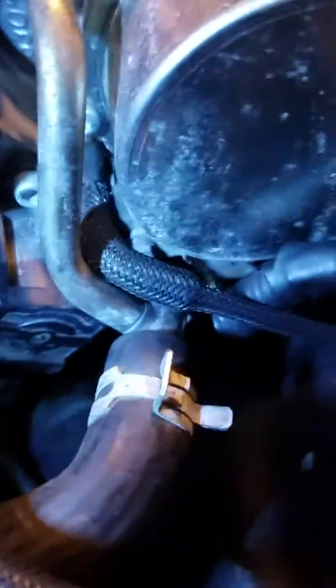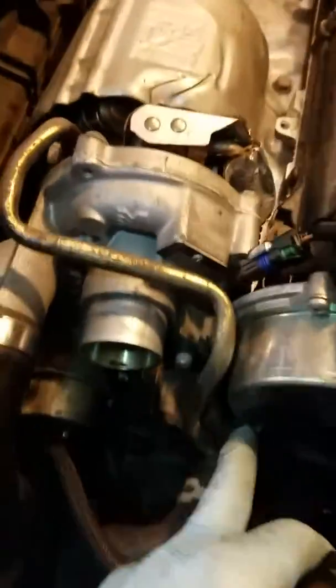Alrighty, so next we're going to remove these vacuum lines to the turbo wastegate. Here's one here. Pull this off, and this is the longer of the two. There's another one right here. Let's see if we can get a light on there a little better. Yeah, there's one right here and here. The guy who did this already didn't really run these back properly. So take them off, and when you reconnect them, this is the one that is longer, and you can see it'll reach out to here, and this one here is shorter, and it'll pop up onto this little nipple. Yeah, a nipple right there.